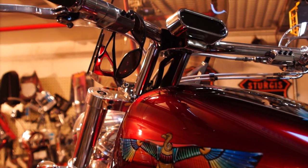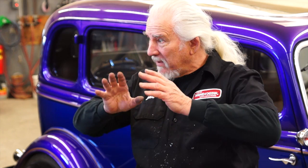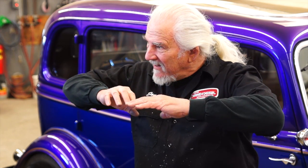And what we used to have to do in the old days is you'd base it the night before you painted, because the base had to be thoroughly dry so you could pump on 6 or 7 or 8 coats of Kandy and not have the base move. And then you'd wait another 2-3 hours before you clear coated, because if you did the Kandy and the clear together, the bases would start to get soaked and they would start to move. Well, when they came out with the encapsulation, I learned that.